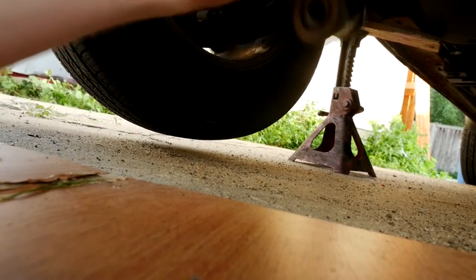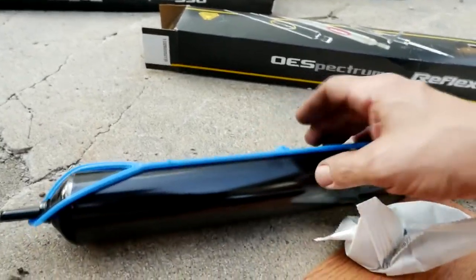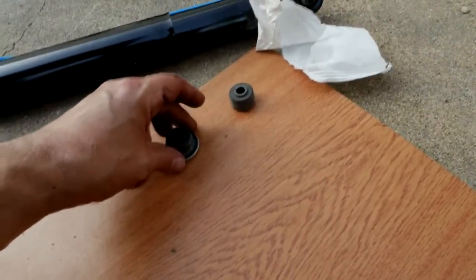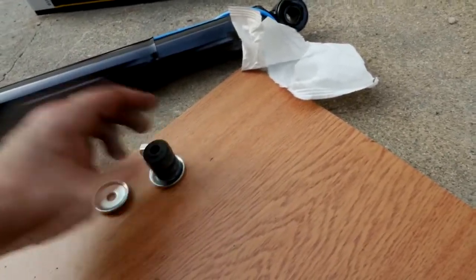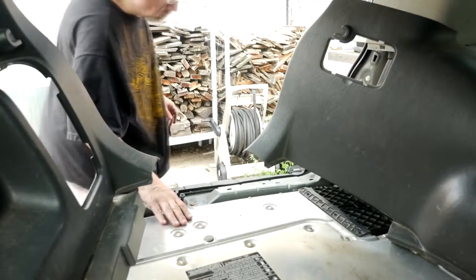The one on the other side was a little harder, mostly because it was still kind of attached on the top. Now, the new shocks have this interesting shipping thing on them to hold them together - there is a spring inside, so if you take that off it's going to extend and you really don't want to do that. It comes with rubber bushings and that's where the body of the car sits. Put the other rubber bushing on, put that on the top, seal it down with the nut, and I had the other capture nuts from before. Getting it in there - you jack up the bottom of the shock absorber and kind of guide it in from the side. It went in fairly easily and I was able to do it by myself. Get that side on, tighten it down and there you go.